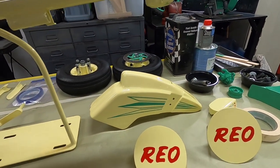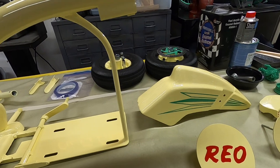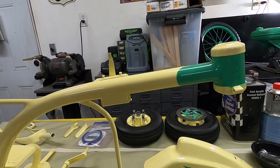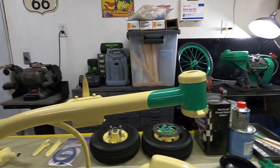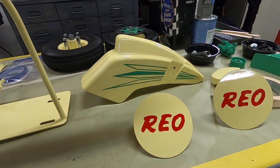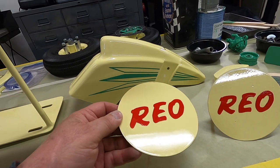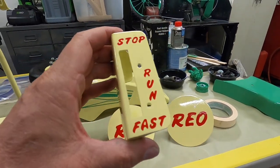I'm going to let this stuff dry — probably until Sunday — and then I'll paint the 'trikeabout' lettering on it. Then I can start putting the engine and wheels on. Now that this is painted, I was waiting to paint this because I didn't want to put it all together and have to cover everything up. The seat I just took off to paint the green, but otherwise I didn't want to risk overspray on anything. That was my holdup on putting it together. Now I can put it together and apply that red lettering. I used Rust-Oleum — misted it on in two really light coats. The first one you could still see the yellow through it, and this one you can almost see the yellow through. I didn't want the paint too thick on there, and it just came out really nice.